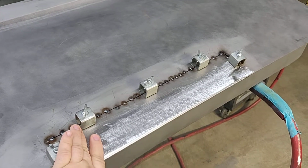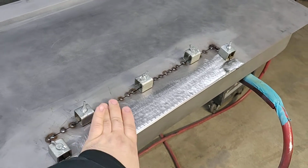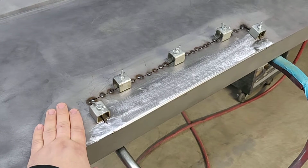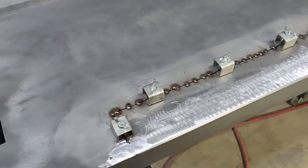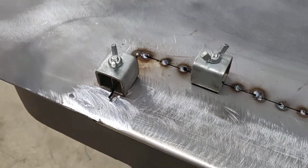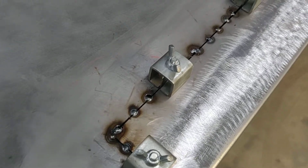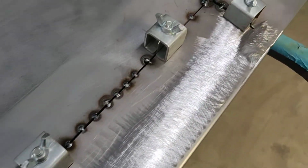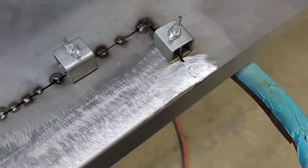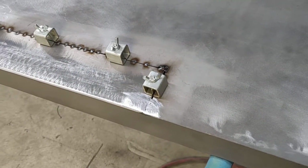This patch panel has been put in, but it's just not a flat piece of steel. It's been curved, okay? We made that curve equal to what the door is. Alright, these little tools, they put a little gap in there, the right size gap. Alright, and it's all the way down. This gives you the proper gap, this gives you the proper fitment of that patch panel, and this is how to properly restore the metal itself.